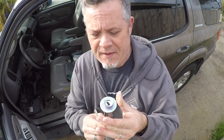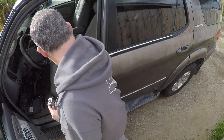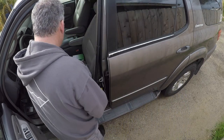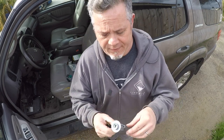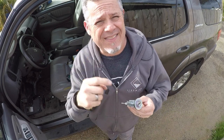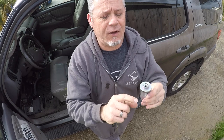Got to share some unfun truth — this is not the original one. As it turned out, the original ignition was far too messed up to be repairable. As explained to me by the locksmith, inside the cylinder there are little sliding wafers: when you put the key in, it retracts the wafers, which allows the cylinder to turn. Toyota used a couple of pairs of split wafers that have a tendency of wearing down and then crossing over one another and getting stuck — that's the problem that happened here, causing the cylinder to get completely stuck.